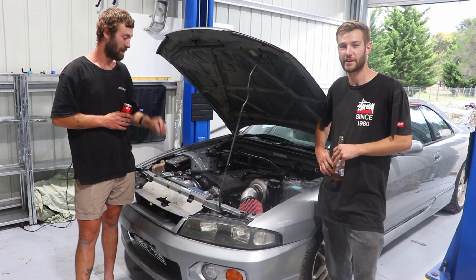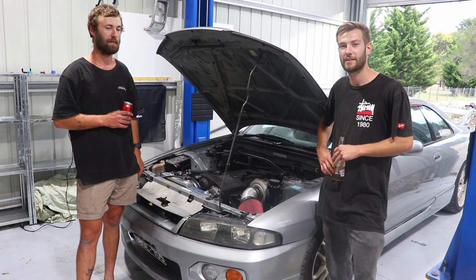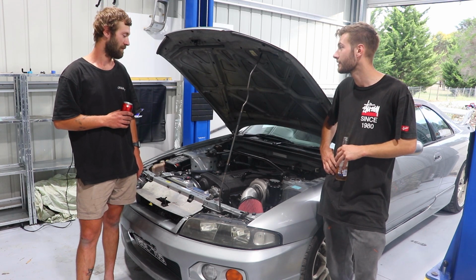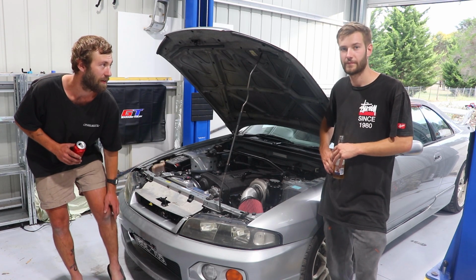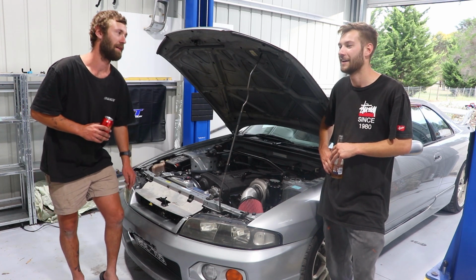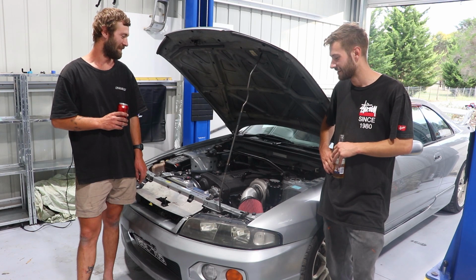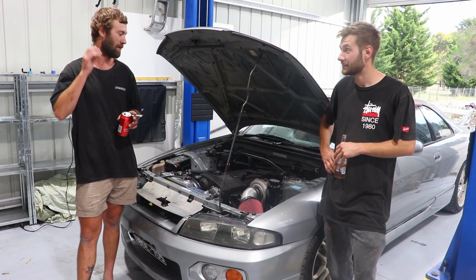Ben's still got to chuck in the flex fuel sensor, put a hardwired relay in the boot for the fuel pump, and finish plumbing up the boost control solenoid. Yeah, change the springs. We've got a 5-pound spring in there at the moment for breaking in, sorry, not running, there's no such thing as running. It's breaking in, up the street twice, and then on the dyno for full power pulls. So it's got 5-pound in, we'll swap that out for the 21-pounder springs for the dyno.